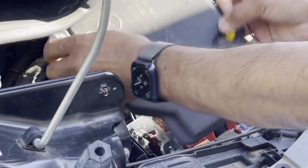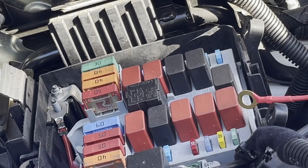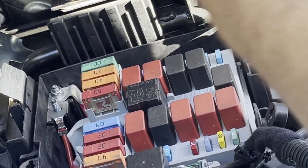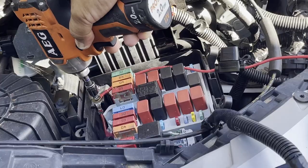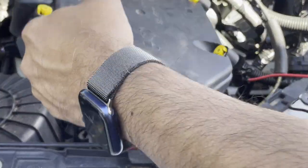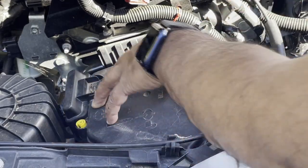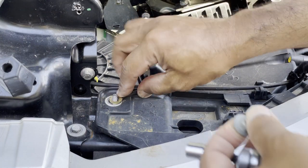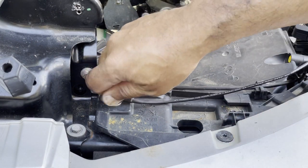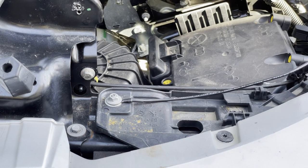Go ahead and open up the fuse box — there are three screws marked yellow, you can't miss it. Then identify the red cable coming from the battery; the battery is housed inside the cabin on the floor. You want to attach the red cable of the light to this red cable, so unscrew the bolt and screw it back on. Once you've got the positive connected, pop back the cover of the fuse box, making sure the fuse is located outside so you can always change it easily. Then connect the black cable to any metal part of the vehicle.